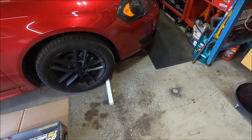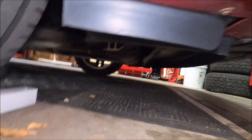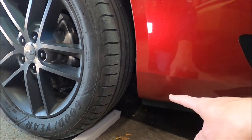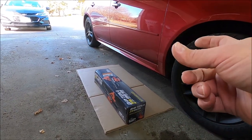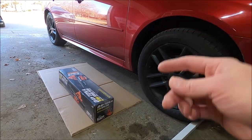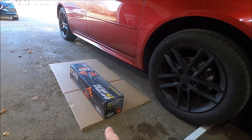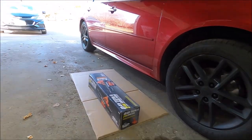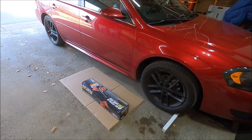Normally, I've showed it on my channel a million times. I go in under here and go up on the front cross member right in the middle, put it in the air. Put the jack stands on the cross member behind the wheels. And in the back, go in under the back, find the center of the suspension where the A-arms go into, jack it up there, put the jack stands on the frame rails. Well, I'm gonna go in with this, center it in the middle, put it out right on the frame rail, throw her up in the air, put the jack stands right on the frame rails. First thing you gotta do, chock your back wheels. Set your e-brake. You don't want this thing rolling forward or back.